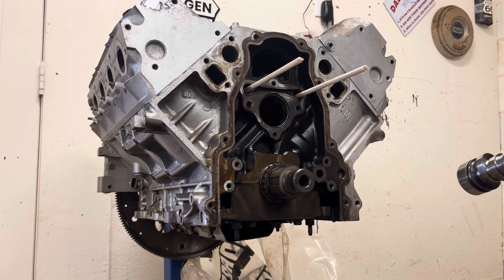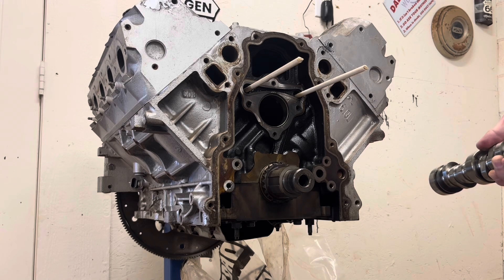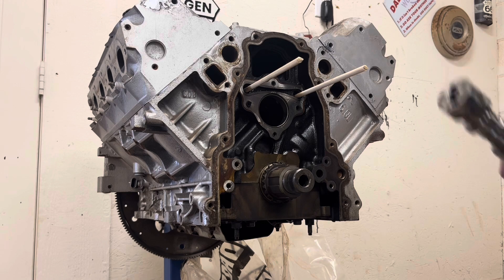And that's how you remove a cam. What the dowel rods do is hold the lifters up in the tray. Sometimes on a lower mileage motor the trays will hold them by themselves, but this is just that extra security so you don't drop a lifter and have to pull the heads to reinstall it. If you like the video, like, comment, and subscribe — this one's super short but we'll catch you on the next one.